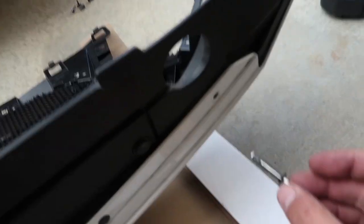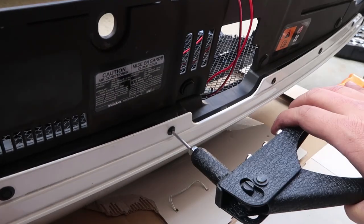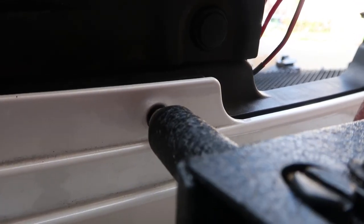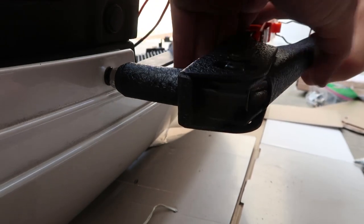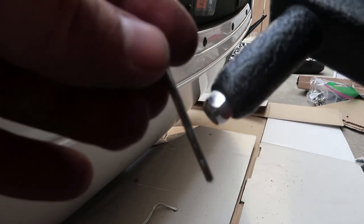Take the rubber gasket off, insert it into the hole — it's a little tight but you can get it in there. Insert the gun, make sure it goes all the way through and touches the rivet. Clamp twice, clamp a third time and the pin will snap off. There you go, it's done.